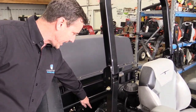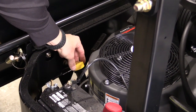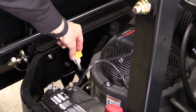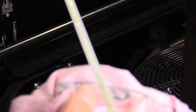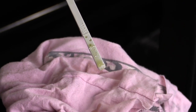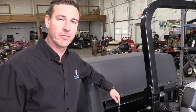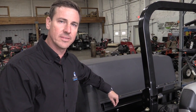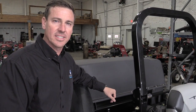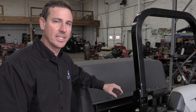The next thing we'll check is the oil for the engine. It's the yellow cap on the Kawasaki engines. To check the oil, you'll unscrew the dipstick, wipe it clean, insert the dipstick back into the tube — do not screw the cap back on — remove it, and check to make sure it's between the add line and the full line. You also want to make sure that the oil is clear and not black. The oil to install in the engine is 10W-40. Too much oil will blow the gaskets, and too little oil will foul the spark plugs and seize the engine.